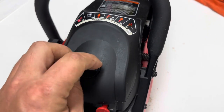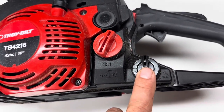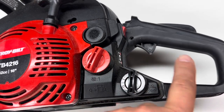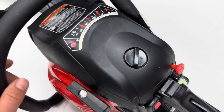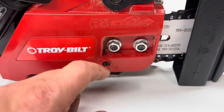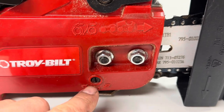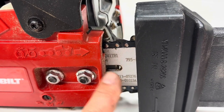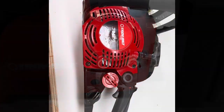On top you have your nut so you can get to your filter — it's hinged, or you can slowly remove it and it just tightens back down. For features I like and dislike: I dislike the bar and chain oil fill being right here. If you watch me pour anything, I'm going to spill it, and I don't like it being on the handle where it could spill. I'd rather have it positioned differently. I do like how you just tighten and loosen the chain adjustment. They didn't get fancy with the bar and chain tightening system — just two nuts and a screw on the side. I like it on the side versus the front, which gets marred up. It's simple to get to.